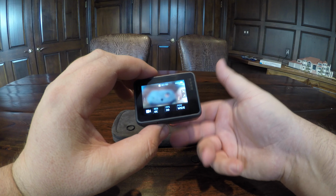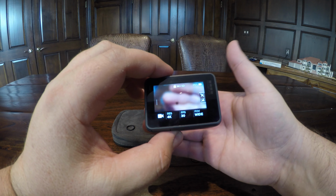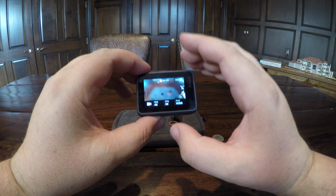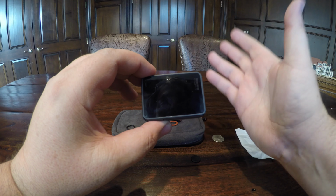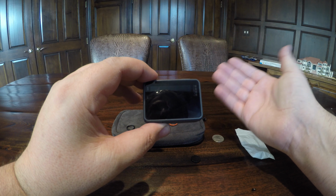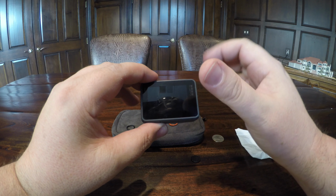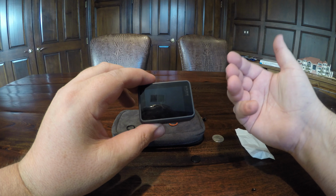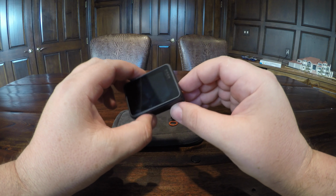Okay, so anyhow, I'll just continuously dial this in by looking at objects as I turn it in. Once I start seeing a little more detail in those objects, I'll focus on something else and keep going. And when it looks pretty close, then I'll actually take a picture or video and put the card in my laptop, with a much bigger screen. Just because it looks sharp on this little 1 or 2 inch screen, it doesn't mean it's going to translate into a big monitor or paper or whatever. So you definitely want to pull the card out, put it on something else, and zoom in and see what the sharpness looks like. Now, Backbone does recommend plugging in an external monitor while you're doing this, but I've gotten it to where I can do it pretty quick without that.